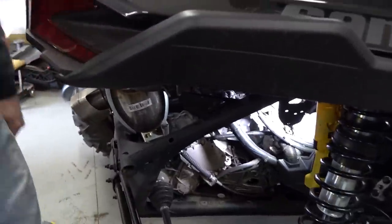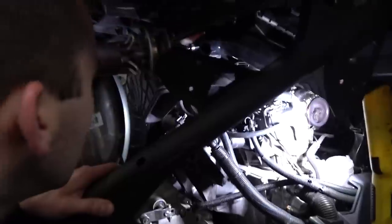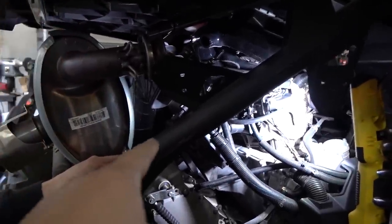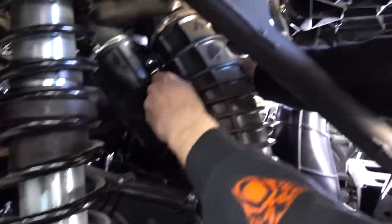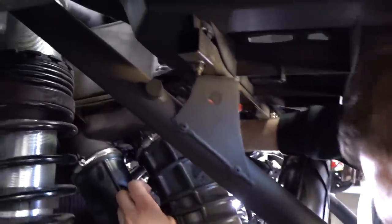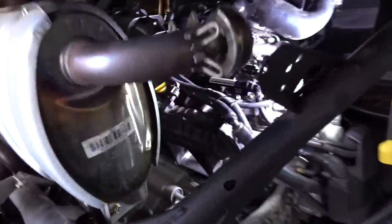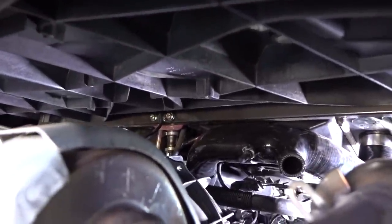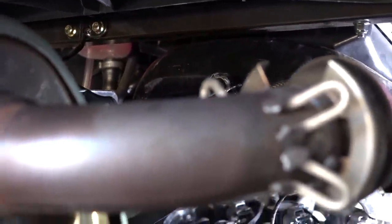In the intake manifold right in the back there's that single lone T-30 — it's a port dummy you can tap into. Rick's going in for the charge tube coming off the turbo into the intercooler on the front — kind of a butthole to get to. You need a lot of extension but we'll get it. Once that one comes off we'll be replacing the tube from the turbo to the intercooler with Evo's larger, better, more exciting charge tube. I'm going to go sync Jason's car — tuning and installing all those parts on two X3s today.